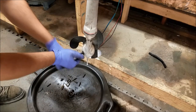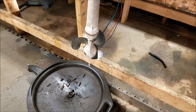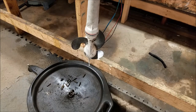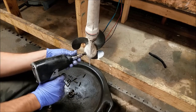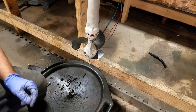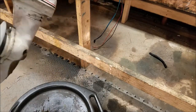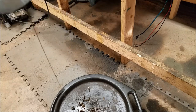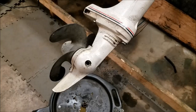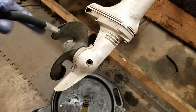I'm going to drain the lower unit fluid here and see how it looks. It loads a little milky — that's interesting. Let's give it a rotate and tilt it up a little. They're not the worst I've ever seen. I'll let it drain out now. Judging by the oil, I'm pretty sure the lower unit is leaking somewhere, but I'm going to hook it up to my gear case pressure tester just to be sure.